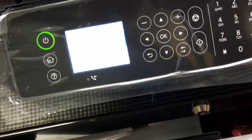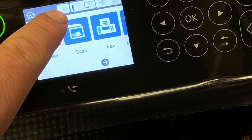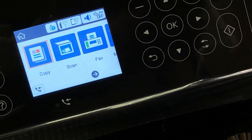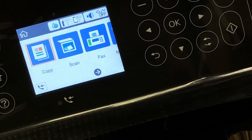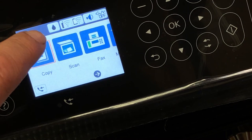Right now it's too early to tell — notice that ink icon on the top corner. It's grayed out right now, so the printer hasn't finished checking the PIS sensor. It's still checking. During this time you can get a 033501 all the way to 033507. Now it's done — you can see the icon become black. No more error codes and the printer is ready to print.